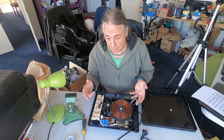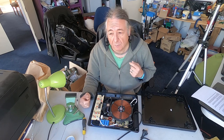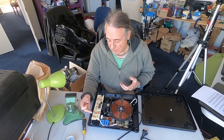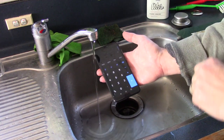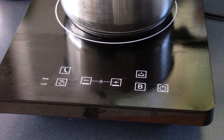Your pan and transformer combo is driven by the electronics down here below, and they work well enough and are perfectly safe in themselves. But where many induction hobs go wrong is in the user interface, where there is this horrible fad for using touch switches. The problem with touch screens, as anyone who's ever had a cell phone get damp will tell you, is that once the screen gets wet, it doesn't work. Even worse, it can send false signals when it gets damp. Here's what happens when I wipe the controls with a wet cloth. And when the pan boils over, of course, you can't operate the on-off switch, and you have to reach over the boiling pan to the wall switch to turn the thing off.